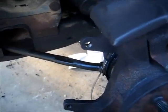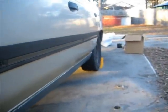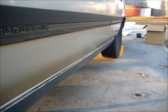I have new sway bar bushings — those are all tightened down. The tie rod ends are in. I have the end link on — these are metal ones from Deezer or somewhere. Of course I have the new bushings in the rear. I'm done as much as I can up front right now because I do need to go buy new rotors. So now I need to jack up the rear end of the vehicle and do the rear brake lines, and that should be enough for one day.